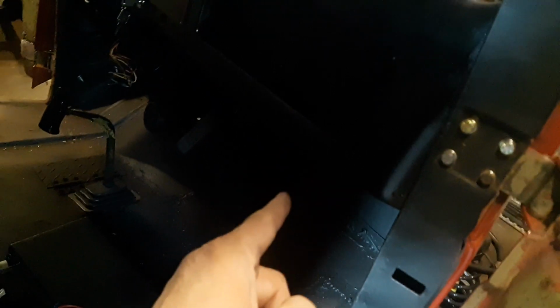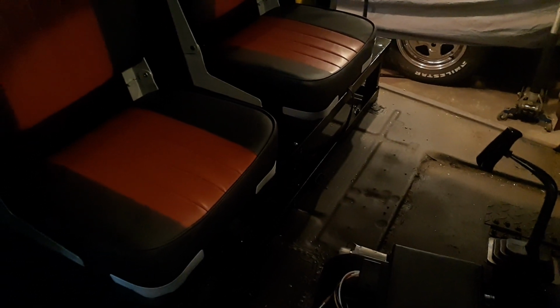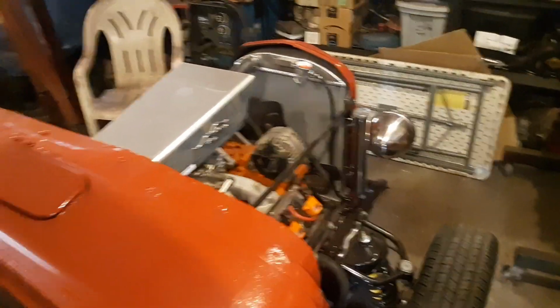But now my evaporator there, I don't know if I'm going to put it underneath the dash. Then I'd have to run the wires up through the floor here and the two hoses. Or if I'm going to put it underneath the seat in the middle. So I think what I'm going to do is get everything ran to the floor, and then I'll measure stuff out. I kind of think the thing would be neat underneath here. But then I just got to run longer heater hoses to the motor out there, run them along the frame rail underneath and then up to the floor into these two.